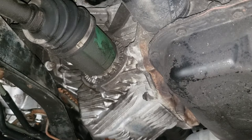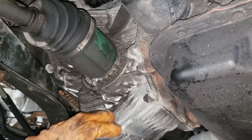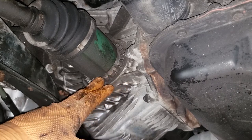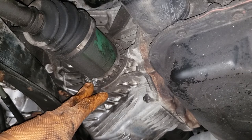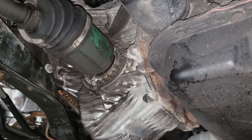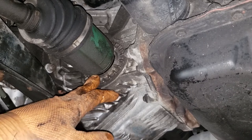Now it's time to pry out our old CV shafts — not the simplest task because you have to be aware of where your pry bar is. There is a ribbed area here where you would normally pry, but the parts here will break off quite easily and this sets the tension on your differential bearings. You do not want to damage or crack this, because you will screw up your transmission — a really bad day at the office. Look for the beefiest parts and pry gently.